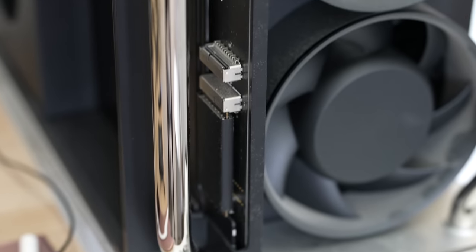We got the legacy ports out, and now for the culprit — the power jack is the one thing that held everything together and you have to remove everything for it. Now for the front USB-C — these are some rigid cables. No Windows manufacturer would ever do this — all these little screws and cables. Why not just have ports that aren't as flush? Well, Apple makes it a really solid system. We now know that if your USB-C connector or HDMI goes out, you can fix it yourself.